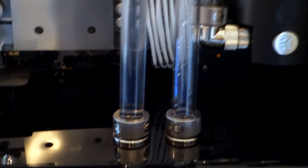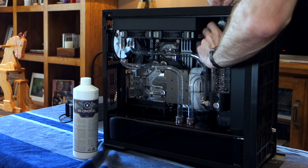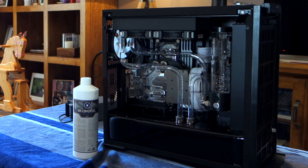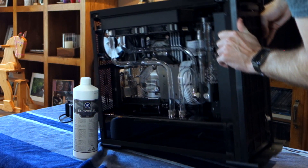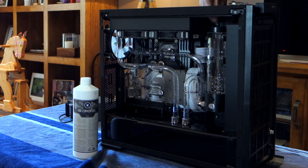What I'll do is try to blow a little bit of air in to see if I can release that through the system back into the reservoir. Even if we were to leave it like that, it's a very small percentage of water left behind. I've got my filling syringe with a little bit of blue tack around the end to create a seal on the top of the reservoir - just plugging it in, getting it airtight, and pumping air in. That's pushing the water through the system and I am actually getting a little bit more out. I'll also tilt the case up and go again, which is getting a little bit more water out of the radiator.